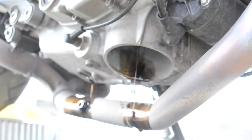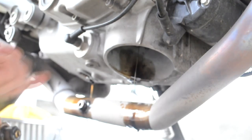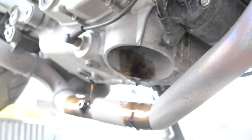While everything is draining, look at this little plug. The crush washer seems like it's still up there, so we'll have to pull it out. This plug needs to be cleaned up — take one of your paper towels. It's a magnet at the end, so there are metal shavings attracted to it that you've got to clean off. And we've got the new crush washer, so once we reinstall it, it's going to be clean.